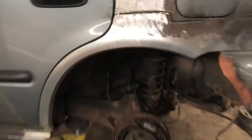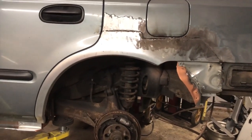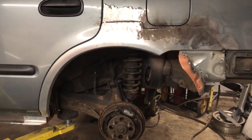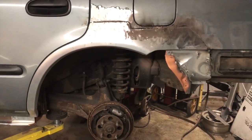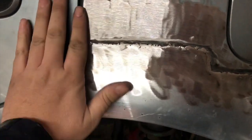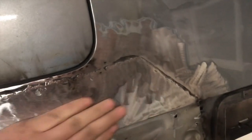So now what I'm going to do is feather this back and actually end up fiberglassing all my welds to waterproof it, and then you can get it filled — which won't be today or anytime soon. Honestly, it's just getting some glass on both sides once the other side's welded in, and then the bumper's going on and then it's going in for the inspection and rebuild title. That way there's no rust, no holes, and it will pass. There's no point in body filling all this to then weld right here because it's gonna burn, right? So I just want to seal my welds and seal the body metal up.